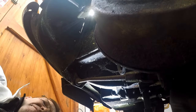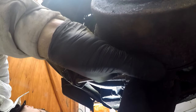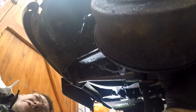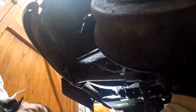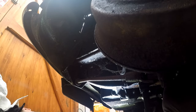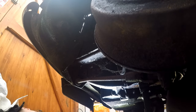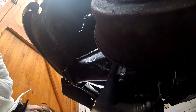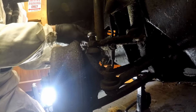You've got twin leading shoe brakes on this haven't you? Well presumably you have, because you've got a brake pipe linking one side to the other, so it must have twin leading shoe brakes. You can see down here where my finger is - that's a brake pipe linking front to back, so it must have another cylinder here and another there. As a drum brake system, it's probably about the most efficient one they developed.